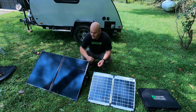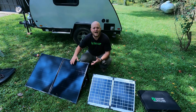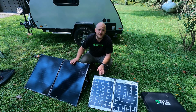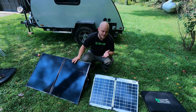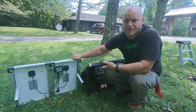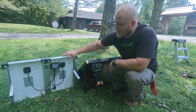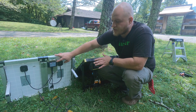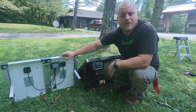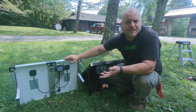When you're looking at these panels side by side, this panel has a much higher quality solar cell — it's a higher quality panel. The Zamp one is not even monocrystalline; some of the new ones are, but the price point is the same. The Goal Zero kit comes with a much higher quality charge controller — you can configure it for lithium, flooded, gel, or AGM batteries. The Zamp is a single charge controller without any capability to modify it. The quality of the wires is different too. All in all, any way you look at it, you're getting a much worse kit for around the same amount of money.